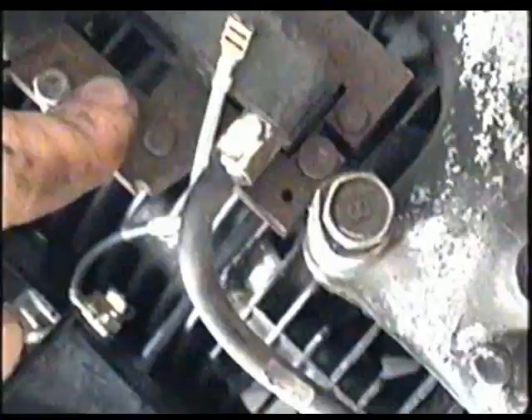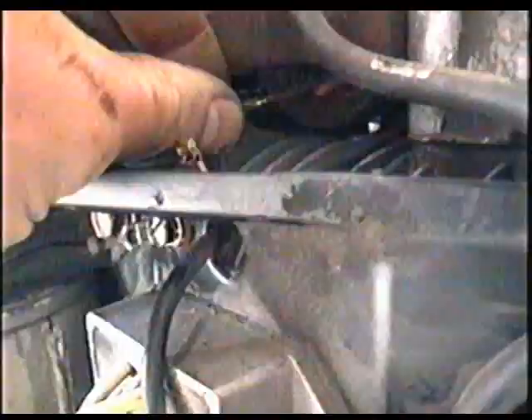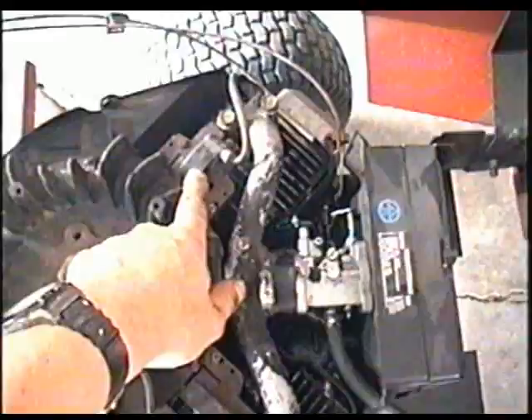Now these wires — one of them goes to the first ignition module and the second one goes to the second ignition module, and underneath here there's a little tab for this wire to go on as well. You can see there's tabs right underneath the coils — just plug it in there. Make sure it's pushed in all the way because there's a lot of vibration. Now run the second wire underneath the first ignition module. It's a bit of a pain but once you get it in there, it's done. It was a bit difficult getting the second wire into the second ignition module, but at this point it's safe to try it out and see if it works.